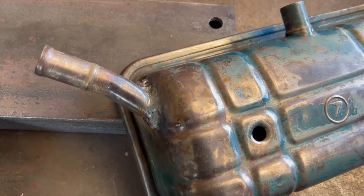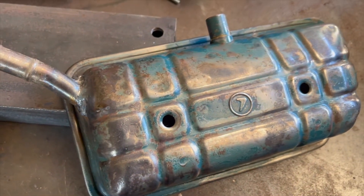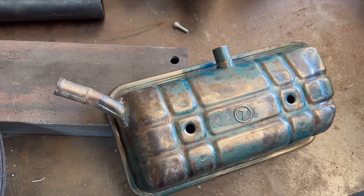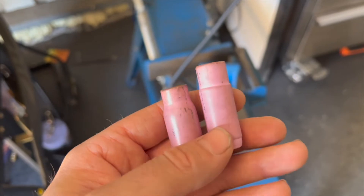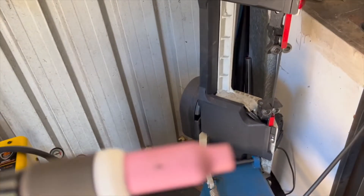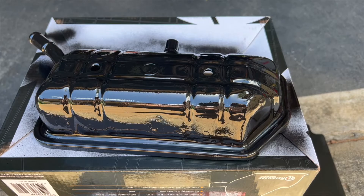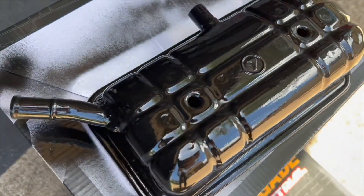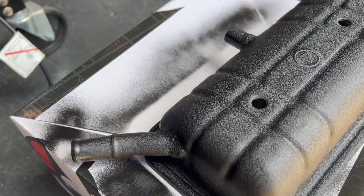That was a right mess - it's super ugly but it's gonna work because it doesn't need to be neat, it just needs to be sealed. The reason why that was difficult is because I was using the wrong TIG cup. These are the two cup sizes I've been using, and for a tight radius like that you just really can't get in there. My recommendation is don't persist like I did - get a more appropriate size. That's a bit of advice from a non-welder. I've just got some trusty wrinkle black to hide those gross welds, and I'll hurry it along with a blow dryer.